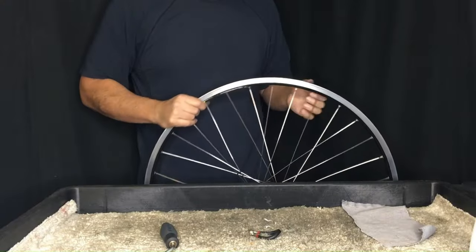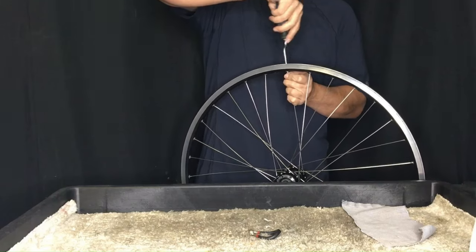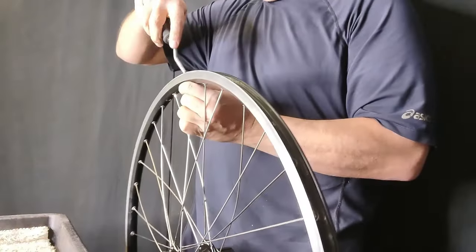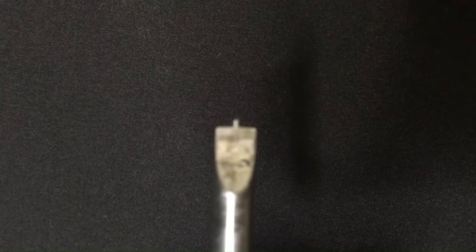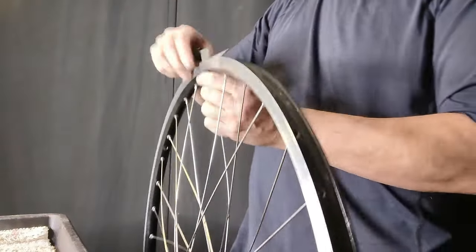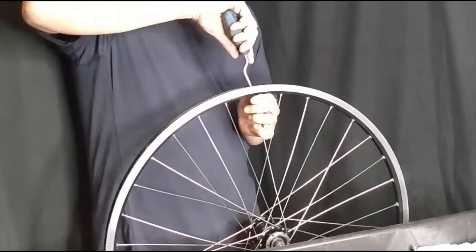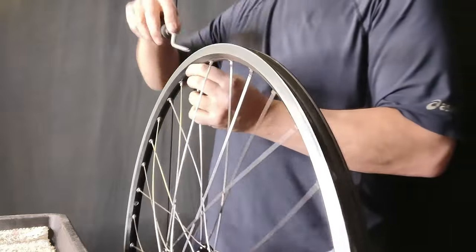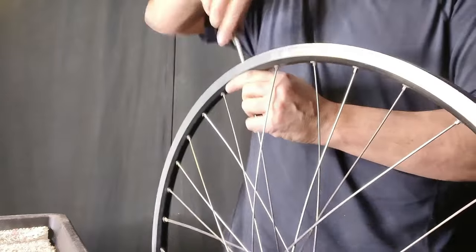Now that we've finished lacing the entire wheel, we're just going to do a quick inspection — we can see there's a good amount of slack. There's another technique that's been around forever, used when we absolutely know our spokes are too long: nipple drivers are designed with a 2mm nib that fits into the top of the nipple. We thread the nipple down until the top of the spoke reaches the nipple flat — this is as far as the driver will thread, so the spokes will be at a uniform point tension-wise. Once we've gone around the entire wheel, we check the slack on each spoke and gauge whether the 2mm or so is going to be enough to achieve full tension. We should be successful, but won't know for sure until we reach full tension in the next video.